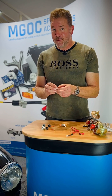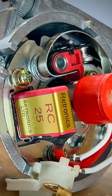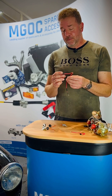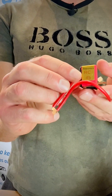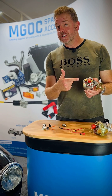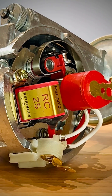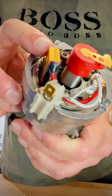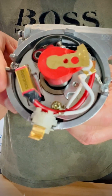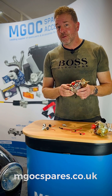It's not difficult to see how it could be made better using modern technology. So what the guys at MGOC have done is precisely that — a modern version using the latest technology. All of these are handmade here in the UK. It's a metalized film capacitor and it's what they would have done 40 or 50 years ago if they had that level of technology at the time. It just goes in any old Lucas distributor — the 25, the 45 — fitting pretty much in precisely the old OE position. It's very simple to fit in minutes, and you've then removed all of that worry, all of that doubt, all of that movement from the older design — something that pretty much is a fit-and-forget item, particularly if you've uprated your rotor arm at the same time.